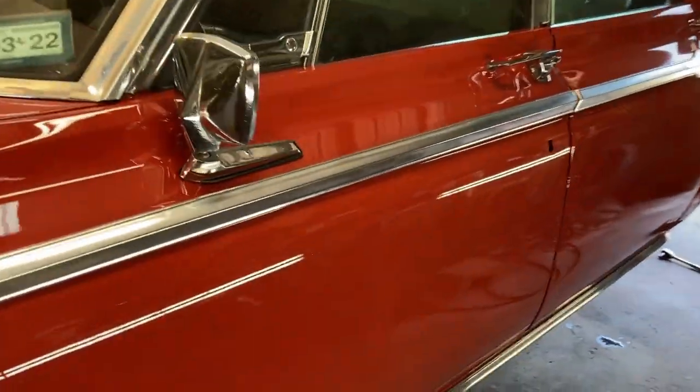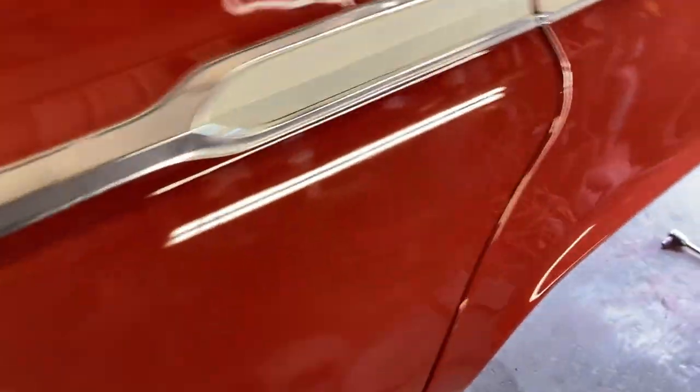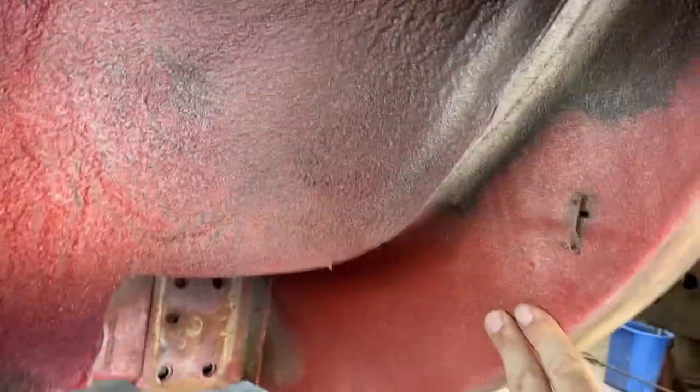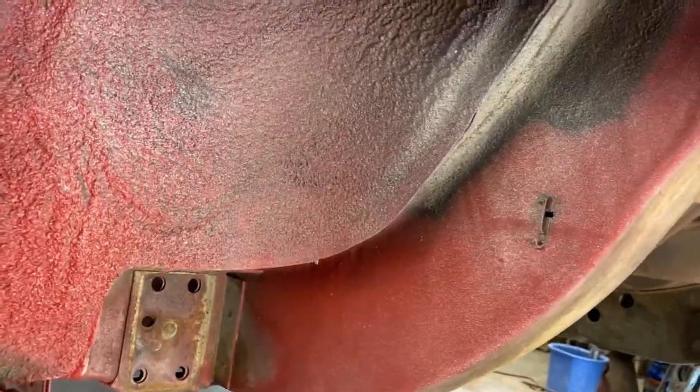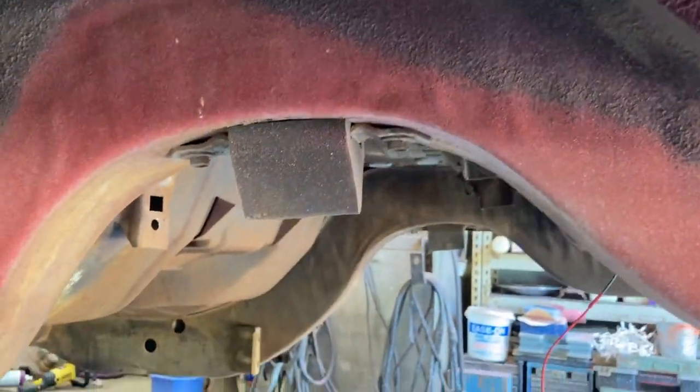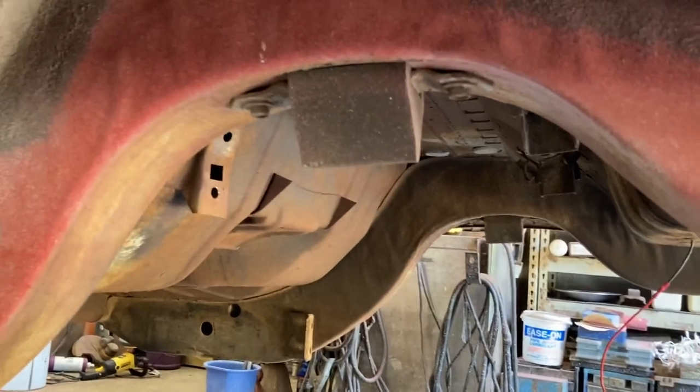After all these steps here, I am going to go underneath the car just with a water hose and red Scotch-Brite and touch everything back up. Go ahead and degrease it and scrub it. I'll do my inner fender, see how they got some red. Kind of the red overspray here. That frame rail is probably factory red, but since it's got overspray, it'll probably end up black as well. It'll look nicer than having that. This car's been painted two or three times, so make it all look nice. I may go ahead and pop my rubbers off as well just to get a nicer job.